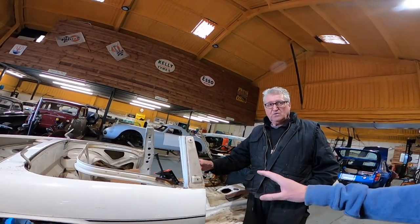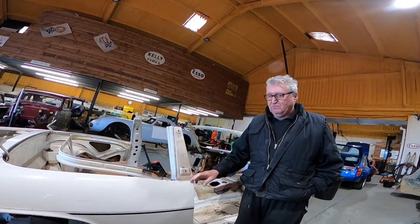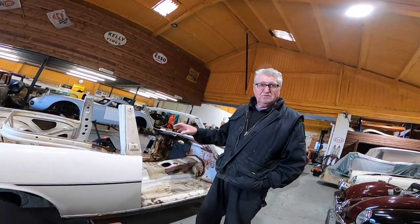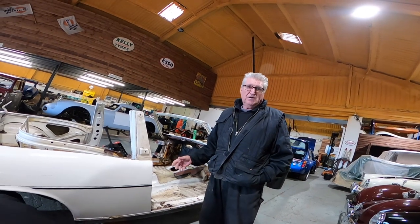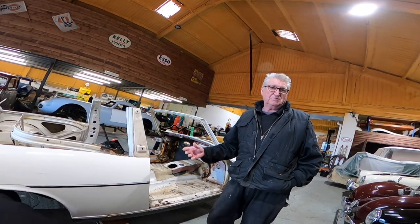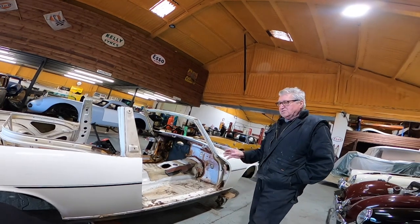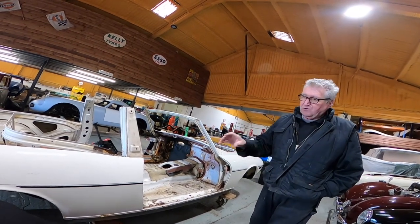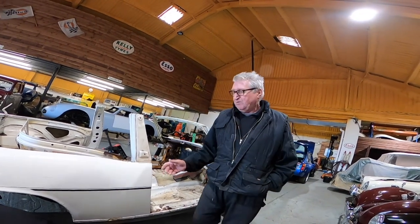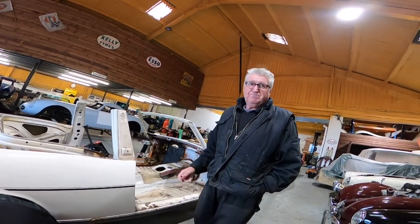If we had the wings off, is there something we can do to stop that permanently? Yes — I'm sure Jason's told you about the anti-chip we use, rather than old-fashioned underseal. This is the more modern stuff, like where Porsche started to use it and Mercedes. It's a really good anti-chip. What we normally do is anti-chip all the inner panels before we put the outer ones on, and we also anti-chip the inside of these. So that'll stop it permanently.